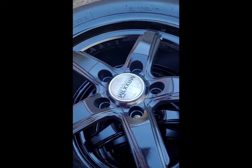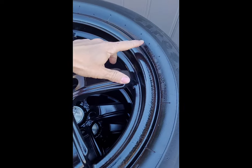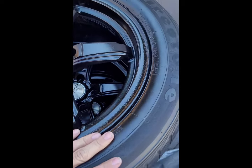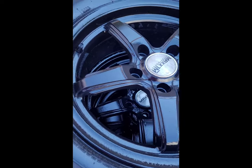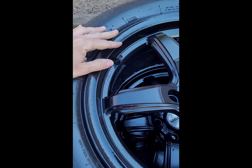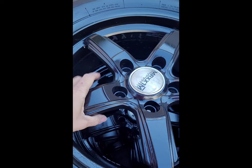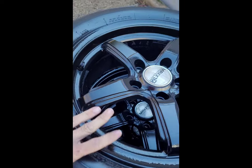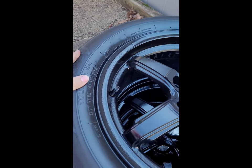This is an aftermarket wheel that I just painted, and we're going with 215-55R16s. These tires are not perfect and will be replaced anyway, but I just wanted to show you guys how thick this wheel is. It's also a little bit wider, so when I put it on the car it did rub, so I had to get these wheel spacers that I got online. Let's take a look at what it looks like.